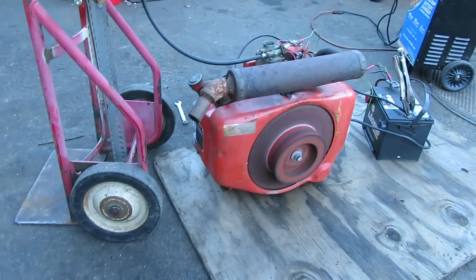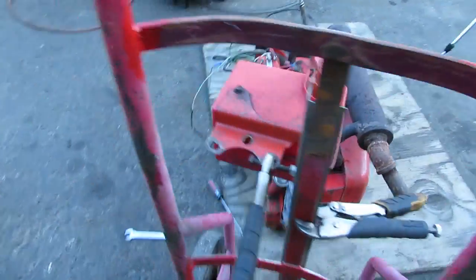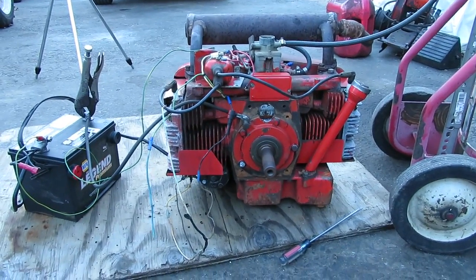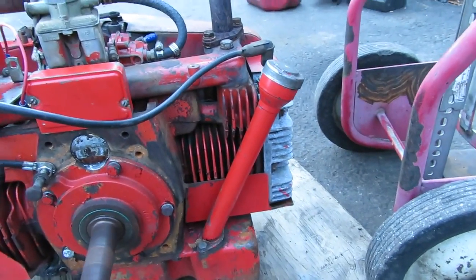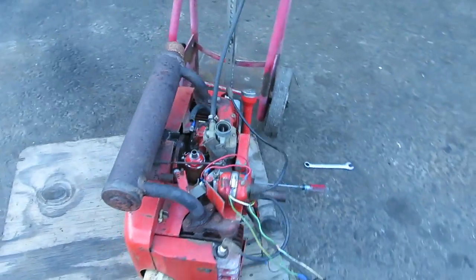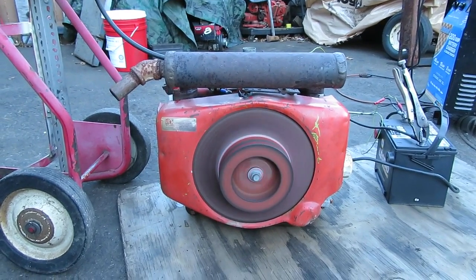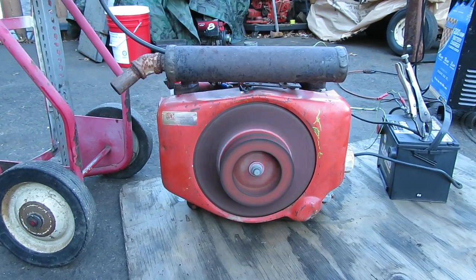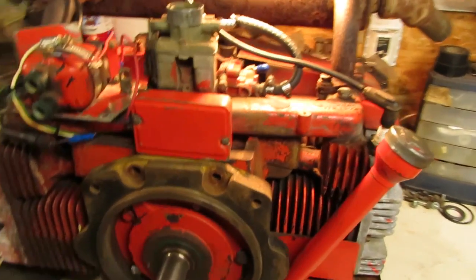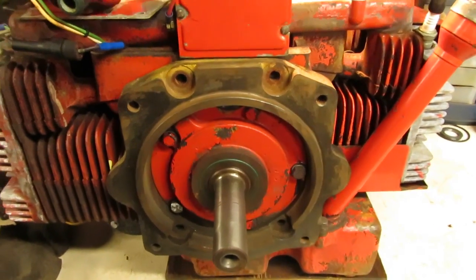This is nice — this couldn't have been rebuilt too long ago. It's got a little bit of a valve tick, but aside from that everything sounds pretty smooth. The valves are going to get done anyway. It looks like we've got ourselves a fine running Onan CCKA, folks. The next step is we have to measure out this crankshaft and figure out where it's going to have to be cut and machined. I cleaned up my 450 adapter plate and I have that sitting on there.